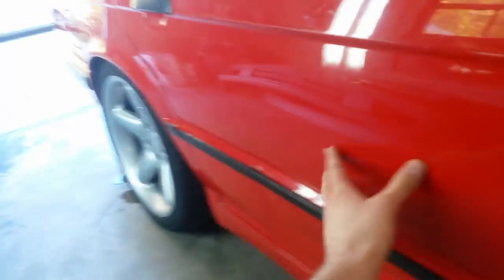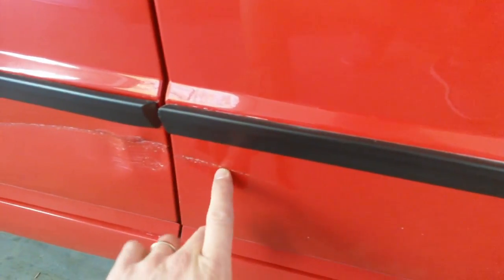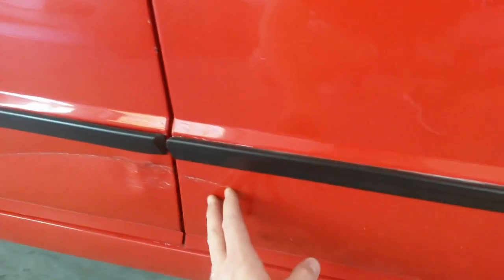We're going to be replacing this door. This is the one that I did some work on a few videos back, and painted the jamb red. There's a little damage right in here on this door where it started. It went into that one, but this is torn under here. Got a hole in it, so we just got another door. This will get repaired. This whole side's been repainted at one time and it's starting to fail. Right in here where they did a little spot repair blend. And it's peeling here. Clear's coming off.